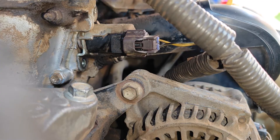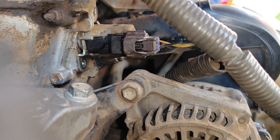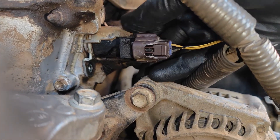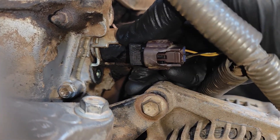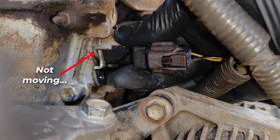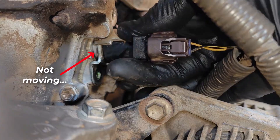At this point, I decided to do something you shouldn't do while removing these valve solenoids — I gave it a couple of taps using the end of a screwdriver. After doing this, I noticed that the metal jacket of the solenoid was now moving independently of the part that's stuck, and that's why I say you should resist the urge to tap the solenoid.